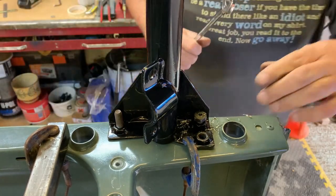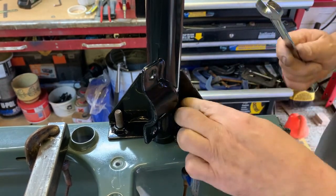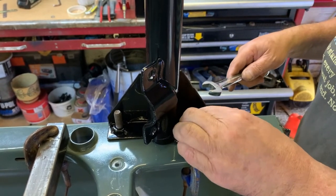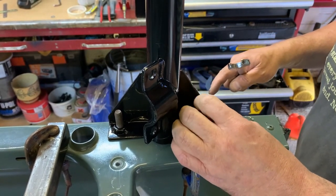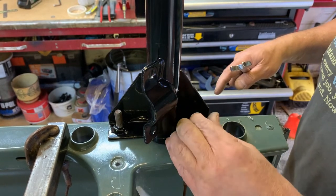And also notice while I'm drilling, you keep pulling the drill up out so that you can give the swarf a chance to clear. And also clean the threads out first because they're full of powder coat. So I have to touch it up, and I've got some chips and scratches on it to touch up anyway. So if it wasn't powder coated, I'd strip it.